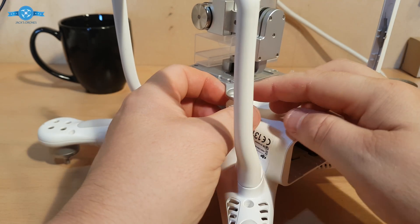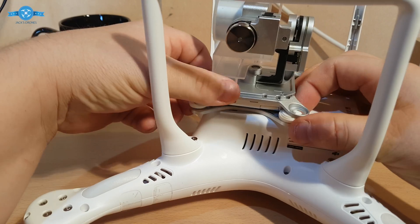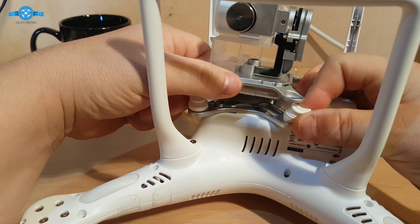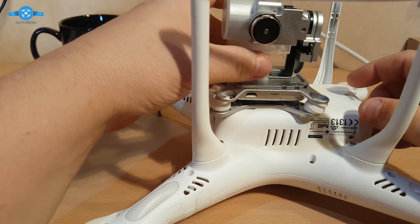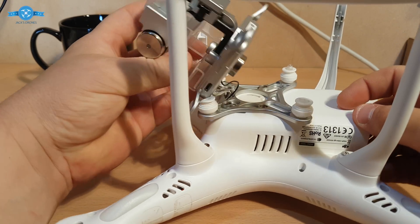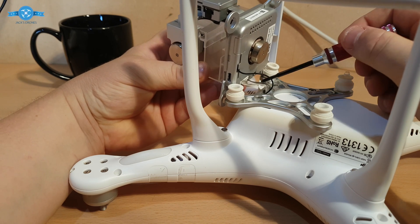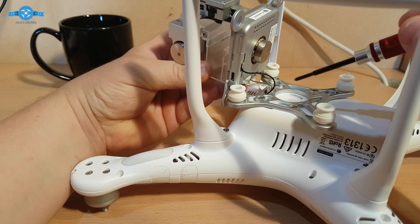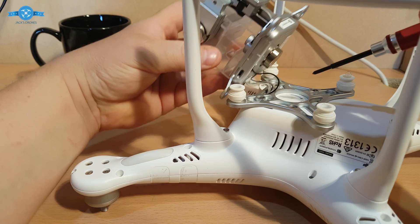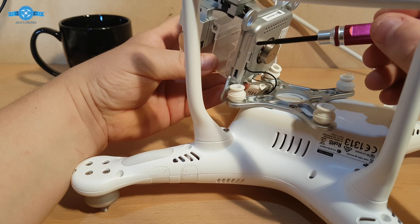After that you pinch these — you just squeeze them, give them a bit of a squeeze and then just pull them out and they can come out really nicely. Once you've done that, underneath you've got four cables. You've got this antenna cable and a grey one here as well, and you've got this grey cable that needs coming off. Before I remove all these cables, the first thing to do is remove these trap doors, which then gains access to where these plug in.